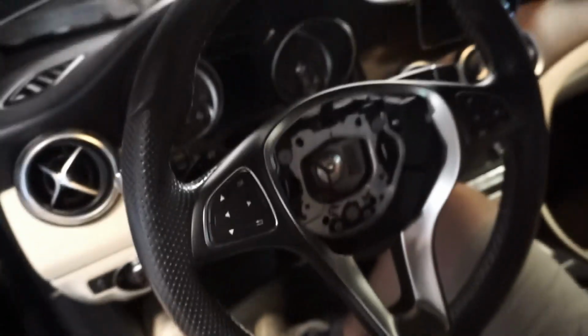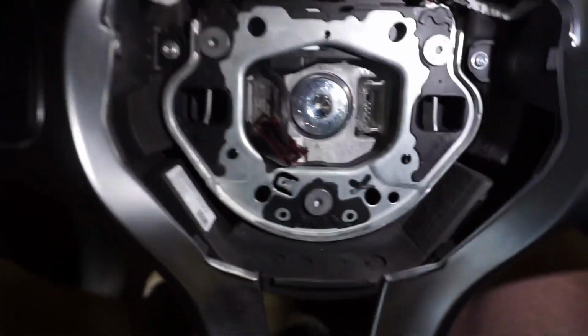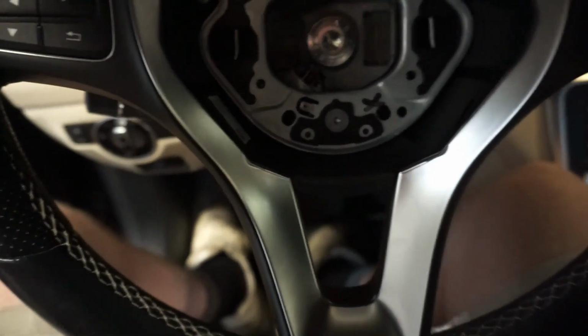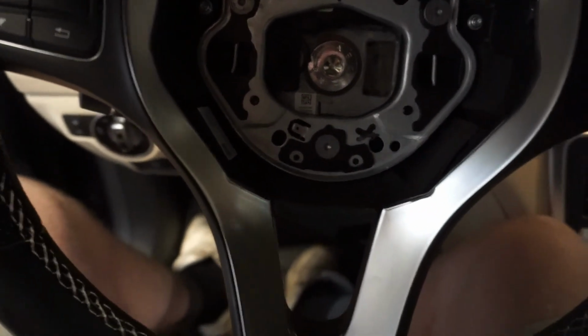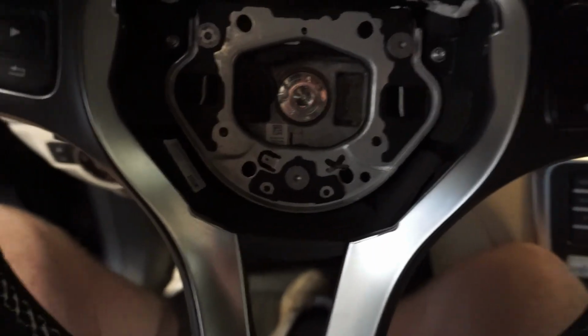Okay, got the steering wheel in. The last thing is, well, there's a connector right here. So you can see there's a connector there. I'll plug that connector in. And then the airbag has that yellow connector there. I'll plug it into the right side there. And it just clips in. So let me see, plug this in. This little purple connector. Plugged in. Airbag. Might have to use two hands with this, but you can see what's going to happen here, right? That gets plugged in and the airbag just pops on. So let me do that and I'll check back.